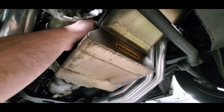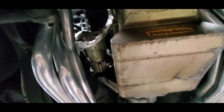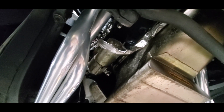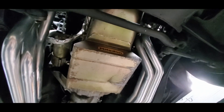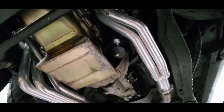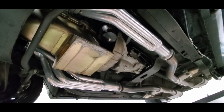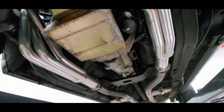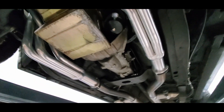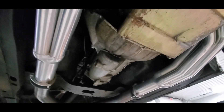Not digging this — this is one of those universal gaskets meant for a passenger-side dipstick. I'm sure they put some sealant in there to keep it from leaking, but it's not actually the correct gasket for this block, because this is a driver's-side dipstick block. If we drop that pan, I've got a different gasket I prefer. We may be able to pound out that dent and make me feel better. On the upside, I know whatever happened here missed the pickup, because we have oil pressure.